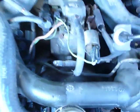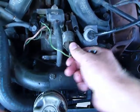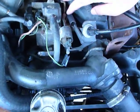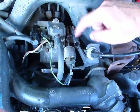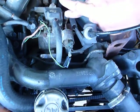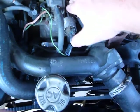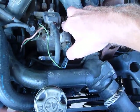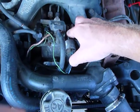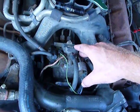Last step — do not forget this. You have to adjust your throttle screw. Here's your throttle spring, your kickback spring, and this is your throttle screw. I have mine set so that it touches the rod and you can push the rod in and it moves about 50 thousandths of an inch, maybe 75 thousandths. I live in Iowa — it gets bitterly cold and really hot — and it works fine for me.